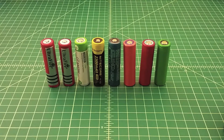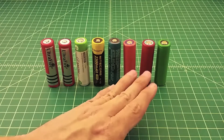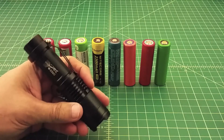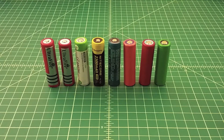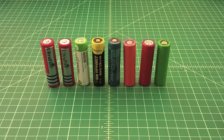Hopefully I'm making sense, and if anybody has any more information or expertise, please comment below and we can have a rational dialogue about it. I stopped using these batteries in most cases, especially in a flashlight where I didn't know if it had integrated circuit protection. For example, this flashlight — I didn't know if it had integrated circuit protection, so I don't use a non-protected battery in that environment, because I could accidentally leave this flashlight on. It could turn on in my pocket or in a bag and cause a venting scenario.